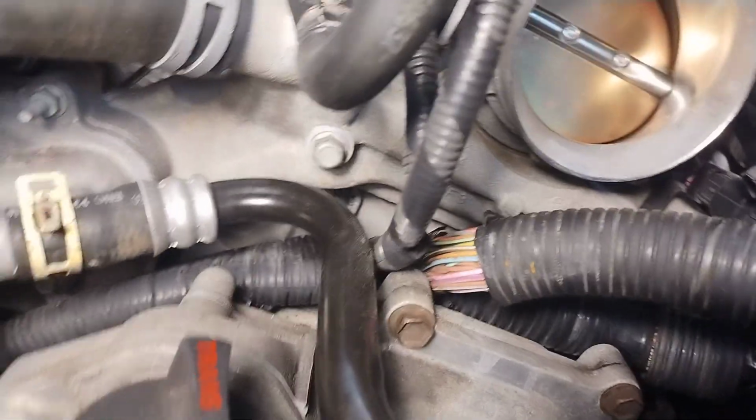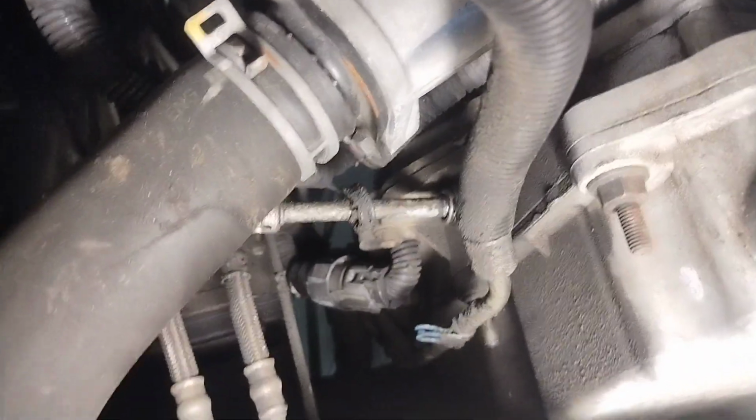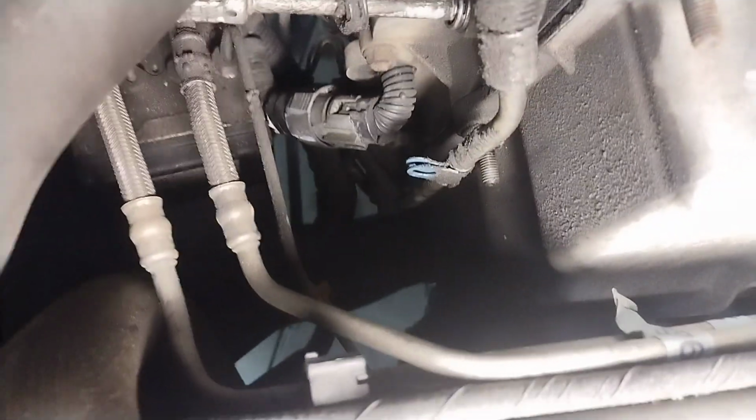And then if you see in there where the hole is, there's one bolt there, and I don't even know if you'll be able to see the other one next to it in that corner. You've got to take that bracket off right there, which goes along the side on those two studs. So you get the detent cable off. I haven't taken the line off yet because I don't want tranny fluid dripping in my face. I usually take the lines off last. And you've got to take that little bracket off for the other cooler line, which also looks like the cooler lines are leaking on this thing.